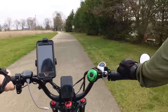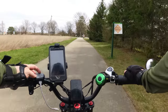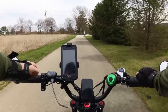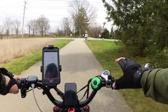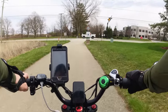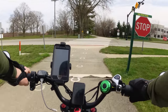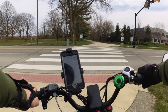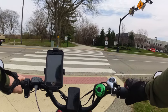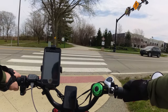So that's how you set it. Again, you hold your information button and the plus key — hold that for two to three seconds for the little dial for the cruise control to pop on. Then you have to pedal, or pedal and hold your throttle, for at least eight seconds at the top speed of the pass setting. There you go.